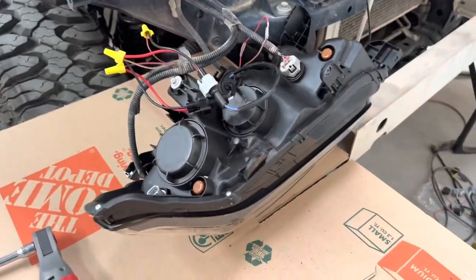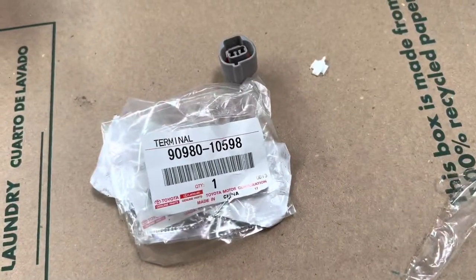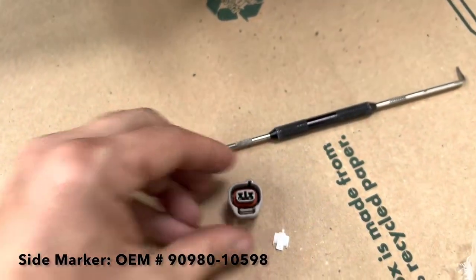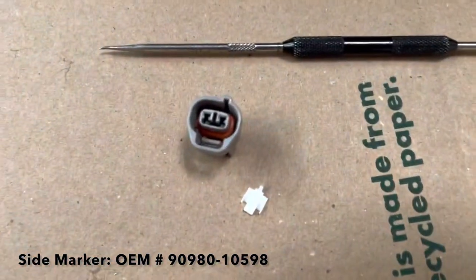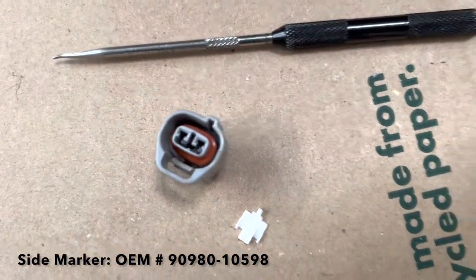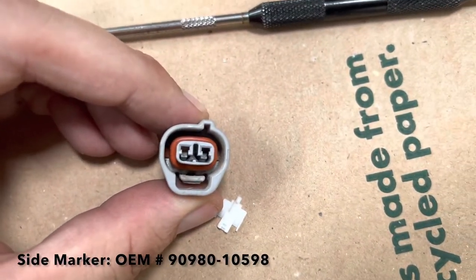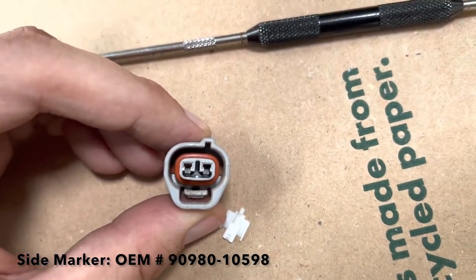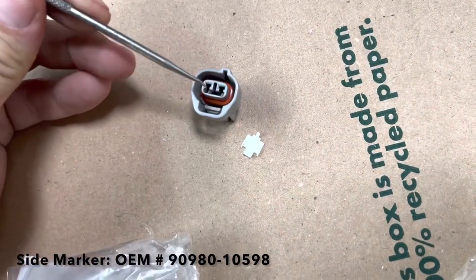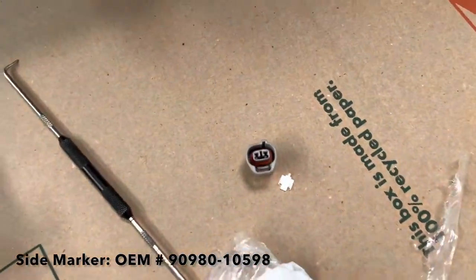Got the headlight back down. First one to start is this part number, which takes care of the side marker. Here's the original from the second gen — there's a little plastic piece that fits in there to lock it. There are little pins and tabs in there that hold the metal terminals, and you just toggle them up with something like a dental pick after you pop this out.